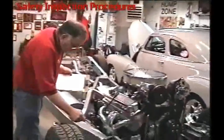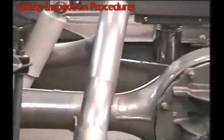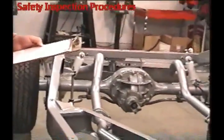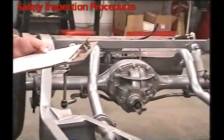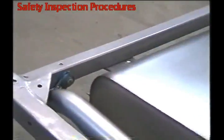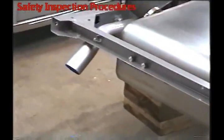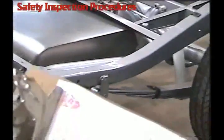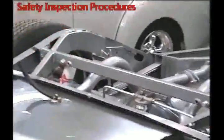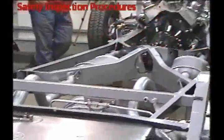We're going to do the exhaust system. What we're looking at is to see that the exhaust system runs either behind the front doors or all the way out the back of the car — no leaks and it exits the exhaust away from the vehicle. Following this exhaust to the end, it comes out past the gas tank and down past the frame. Remember, you'd be looking at the exhaust from the bottom, so use a mirror and flashlight to help you look under the car.